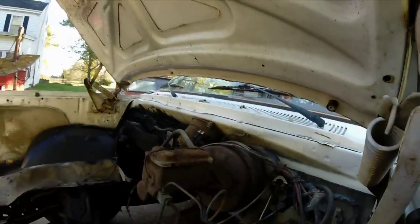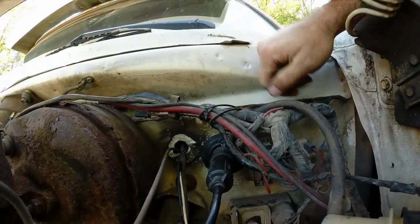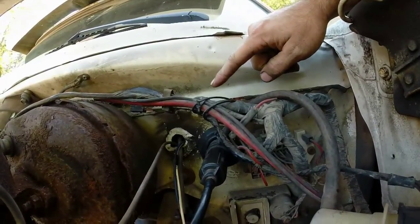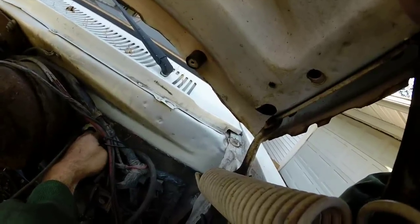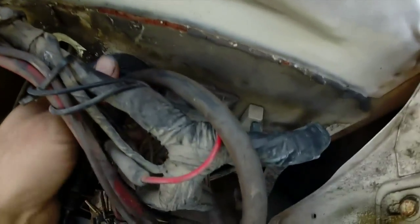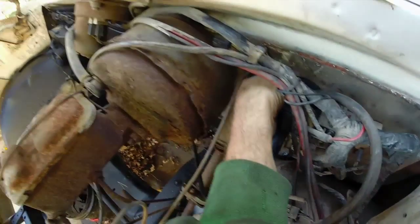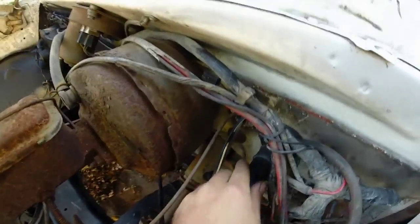I had the hydraulic setup for this truck, but normally where they bolt in on the 92s and 93s, they won't clear the bulkhead. So what I've done is hole sawed this as close as I could to the bulkhead wiring, and I cut the bracket down a half an inch on the inside in order to get it all to fit. And it does.